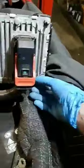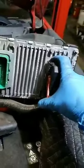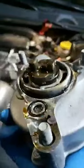This bracket right here has three bolts — one here, one here, and one up top. I take this ground wire off with the nut so I remember it. I don't really like to mess with connectors, so I try to avoid them. For the PCM I just put it to the side. Disconnect the battery — I like to put a cover so it doesn't touch. The vacuum pump here is very important for your brake booster, so put it in a bag — don't contaminate it.